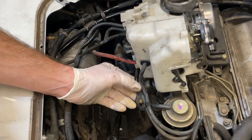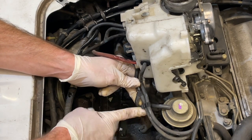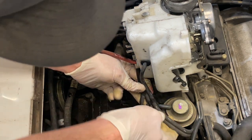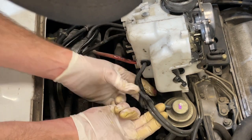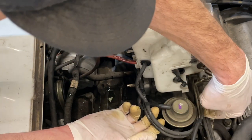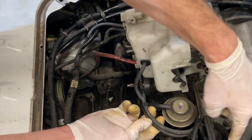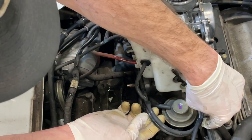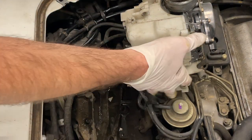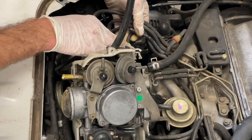So I'm looking at this little Y here, which is gonna need to come off. I'll take that Y off there. Also looking at these two hoses here, my fingers are at here. I'll take those off the metal piping there because they're, again, low probability of breaking. So once I get these two hoses off, break this T connection here, we'll roll this carburetor down. And over here on this side,